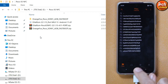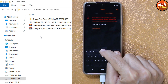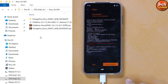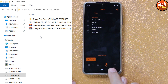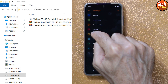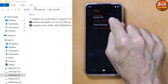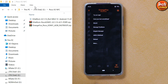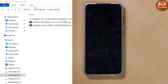On the mobile phone screen, tap the third menu and tap 'Format Data', then type 'yes' and tap to confirm — formatting will start and complete. Disconnect the cable first, then tap the back button, tap the last menu, tap Settings, then tap Display, bring the timeout to maximum, and make the brightness maximum so we can see clearly. Go back and tap Reboot, then tap Recovery so the device starts booting back into custom recovery.